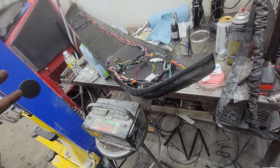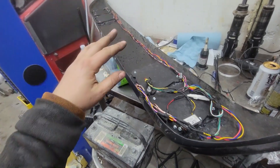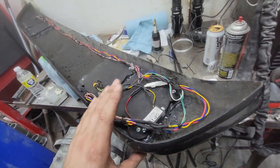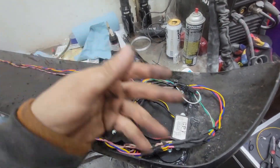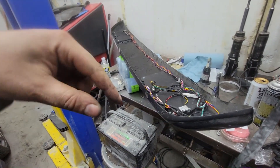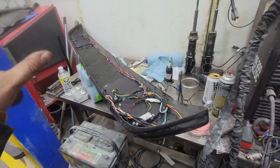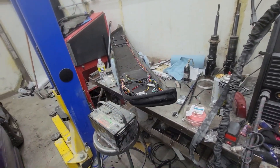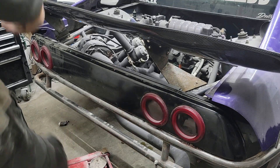I'm not very good at this informative stuff, and this research isn't fresh in my mind — I did it last year when I redid this. Basically all I'm doing is rewiring what I had before. We have 12 volts for one blinker, 12 volts for the other blinker and brake for both, plus the controller. I'll try to find some wiring links and put them in the description or on screen. I got asked a lot of questions when I made these taillights — everybody wanted to know how to wire them, so hopefully that helps.